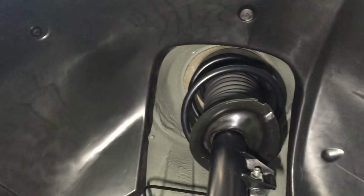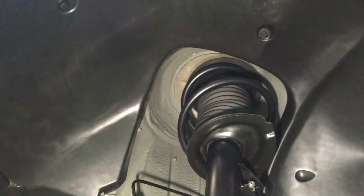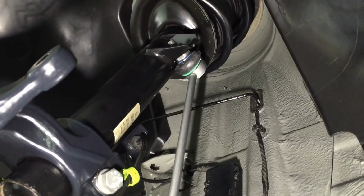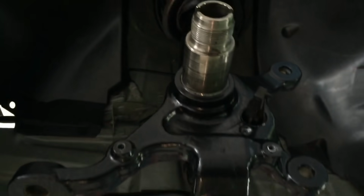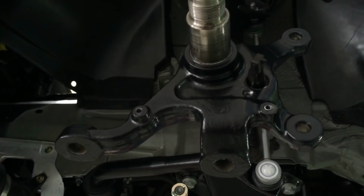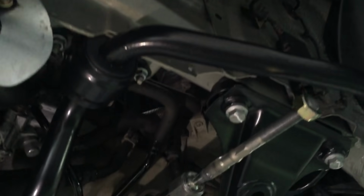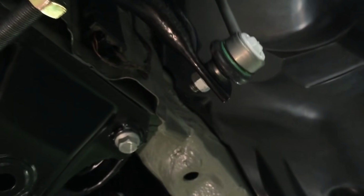So that's the front struts, front springs. We've got new dust covers for the pistons, new bump stops inside there, new BMW drop links, anti-roll bar drop links. And then the kingpins here, which again has been powder coated, where the hub's going to sit next on the wheel bearing, and the CSL anti-roll bar, which is again unique to the CSLs. They're hollow roll bars, and they're a slight bit bigger than the factory M3 ones.